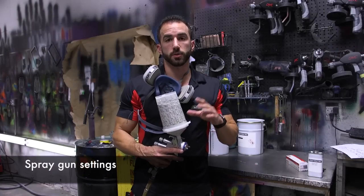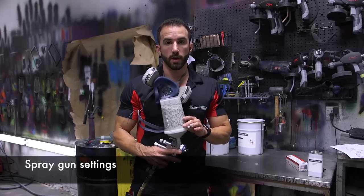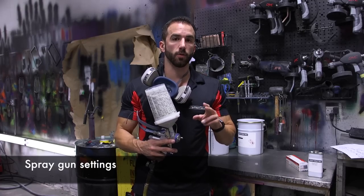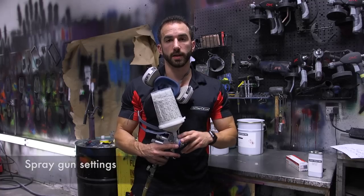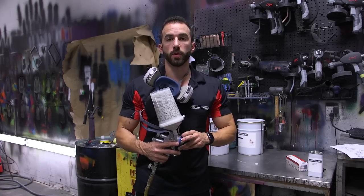We've got our light gray Spray Wrap Pro loaded up into the gun and we're ready to start spraying our light gray coats. We're going to be spraying the Spray Wrap Pro out of a 1.8 tip at 20 psi. And again, starting with 2 tack coats, and all coats after that will be wetting out.